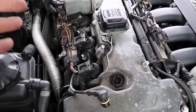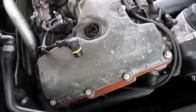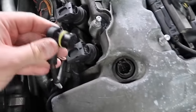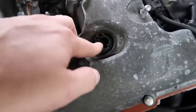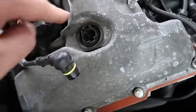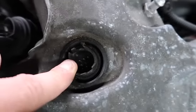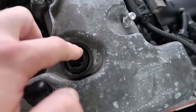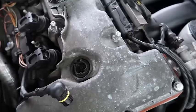A lot of people overlook this as the problem and replace everything — ignition coils, Vanos solenoids — and the problem is still there. It's usually down to this main culprit. Lift this plug up and check you don't have oil inside, because it's common for oil to get into the plug hole right here. If there's oil, you'll need a new one — oil destroys them as soon as it gets in.